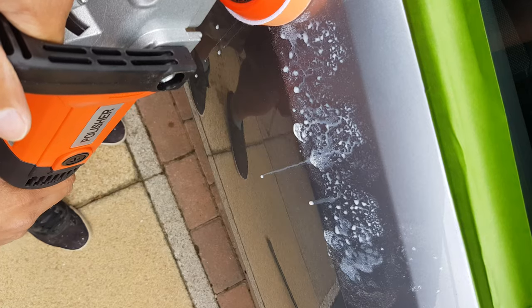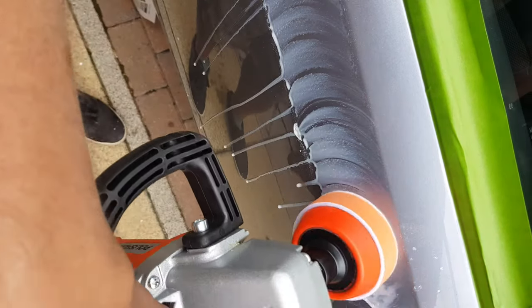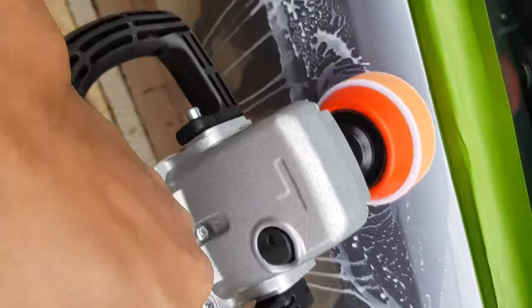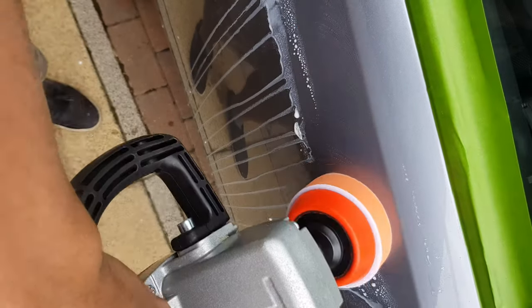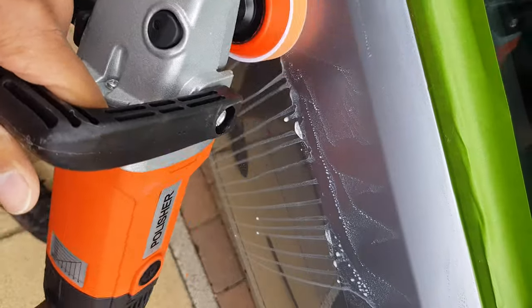You can see I'm using a smaller pad here to polish the door — I could have used the larger one but found it just keeps jumping. I probably used a little bit too much water as it was really aggressive. I made sure to move from side to side and top to bottom as well, using a crosshatch approach so you're handling both sides. You don't want to go in just one direction or you may miss some of the scratches.